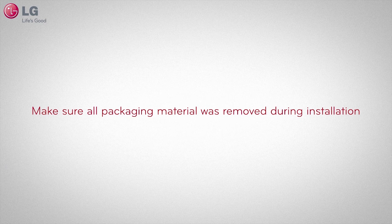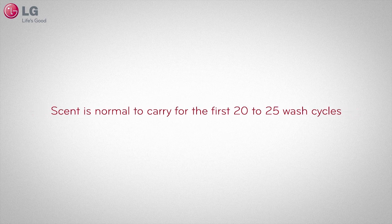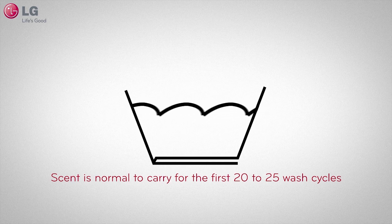If you have recently purchased your LG dishwasher and are experiencing a smell of burning plastic or rubber, make sure the packaging material was removed completely when installed. It is normal for most new dishwasher units to carry this scent for the first 20 to 25 cycles.